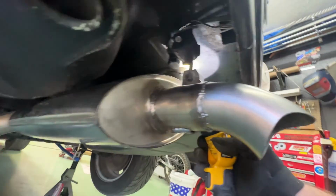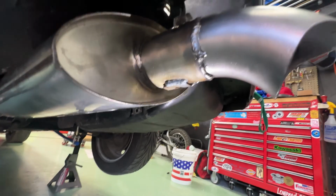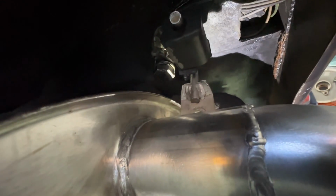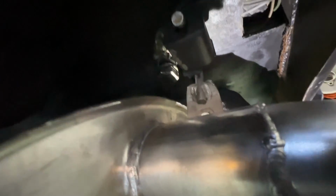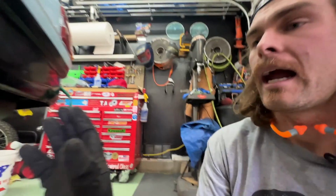I wanted to bring you in and kind of show you what I've done, because it makes sense, I think. We cut down that bolt shorter up in here, which was cool. And then we have our nut up in there. What I did was I pushed that up against a thread insert and then put our bolt in there, so it all threaded at the same time, because I want that nut as high as I can get it. And it came out pretty good.